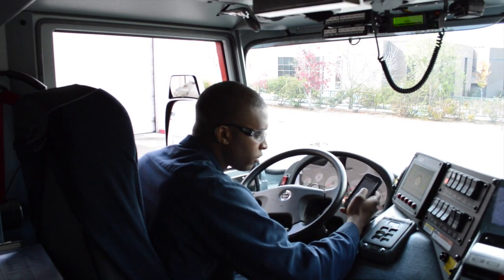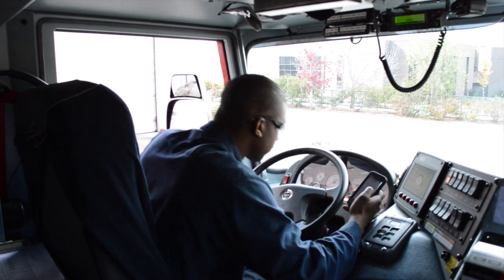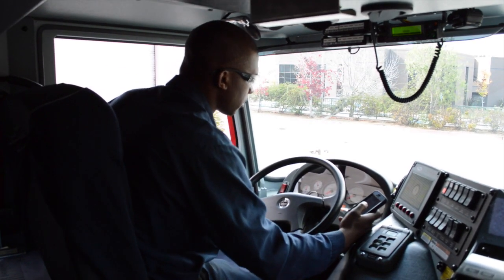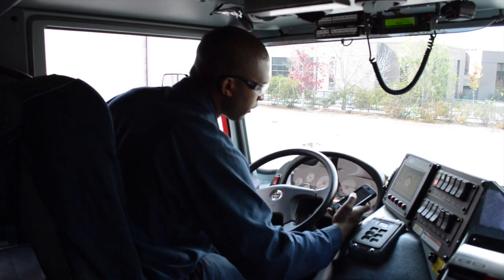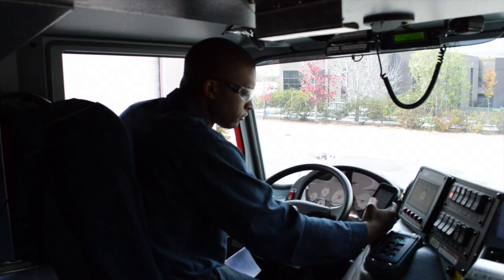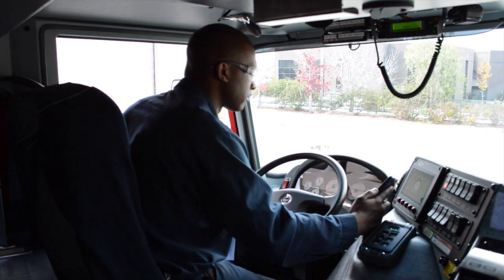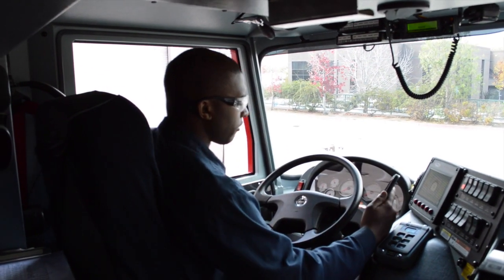We can reset our timer and move into our applied stroke. The same principle applies. We are going to do a full brake pedal application. Our needle is going to move because our pressure and our brakes have been applied. Once they both stop, you start your time for another minute. We have reached a minute. I looked down at the gauges and I have not seen any air pressure loss on the front or the rear brakes. So I can release them.